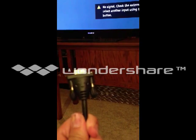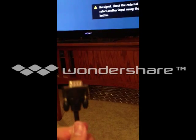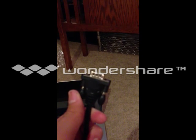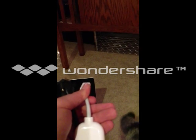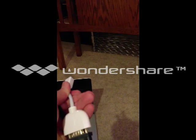You've got to have the VGA connector — a pretty nifty little thing that sends a video signal from one item to another. If you think of a regular PC laptop or desktop, the tower usually has this connected to the monitor so it can send the video. With external audio aside, this is just a video cable, nothing more. For a Mac they're kind of funny, so you need an adapter — it's a VGA to DVI or mini DVI depending on your computer. We'll get this hooked up.